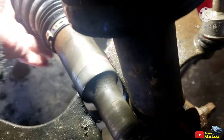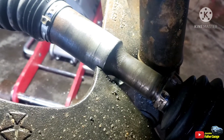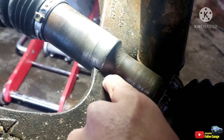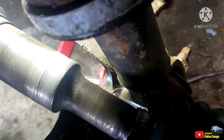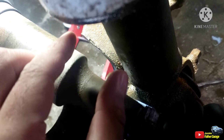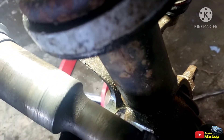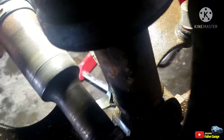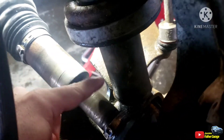I'll show you here — this is where it was sitting on the lower control arm, just keep grinding and grinding. The CV axle was spinning because of the tire spinning. What caught my eye is, while it's grinding and spinning, look at this lower control arm — I'm gonna get a good view here. It was sitting like that the whole time while the vehicle was moving, and it ground this lower control arm off. Look how much material came off here — this is supposed to be a solid piece of metal, and it ground it right off.